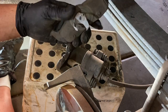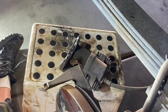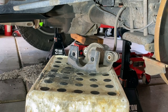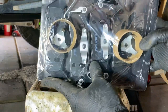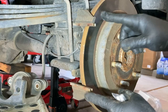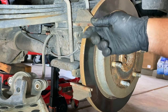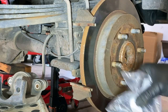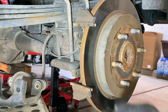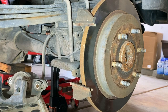Okay, now that the piston's back in, let's grab our new brake pads. Here's our caliper with the piston pushed back, ready to install the pads. Here's our brake kit — the whole package. It also comes with the clips. They are a pain to take off, so if they're not rusty and bad, just put some lube on them and leave them in — that's what we're going to do. We'll put the new clips in a bag for somewhere else.